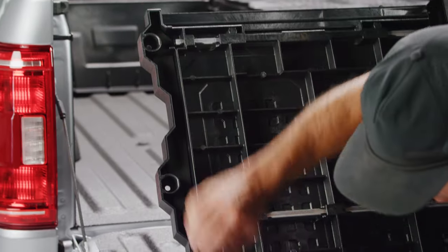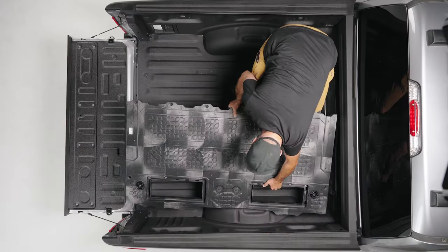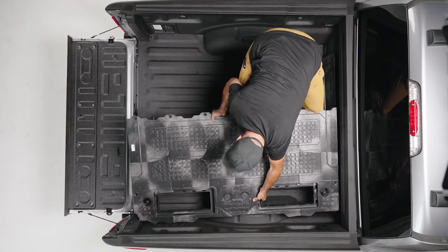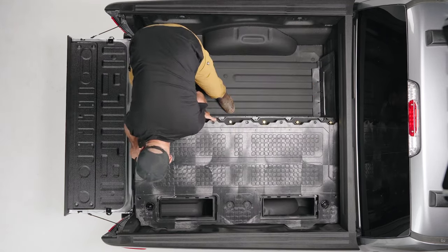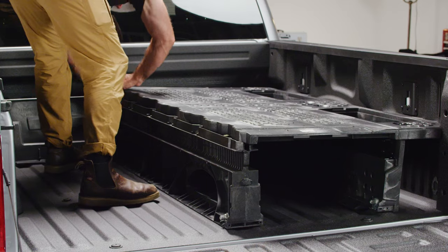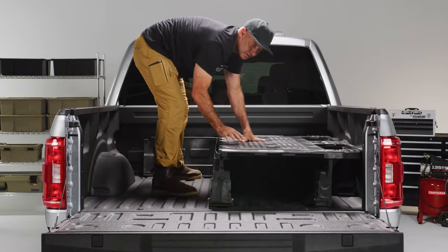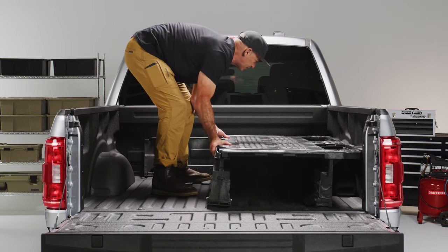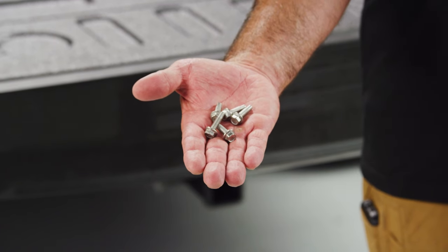Take a minute to inspect the gasket both in the center vert and the deck panel, ensuring they're in place and not slipping out. Walk the assembly into place towards the cab and seat it, taking care to make sure that the cab side closeout — the T — is fully seated underneath the cab side portion of the deck panel. Press the zigzag onto the center vert making sure the gaskets remain in place and do not get folded over.